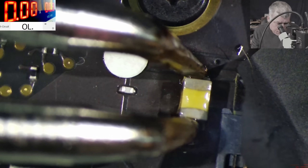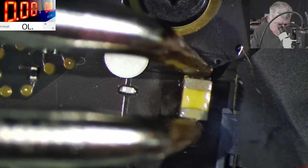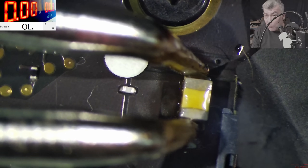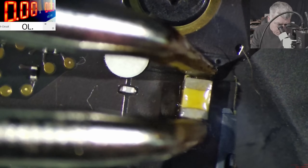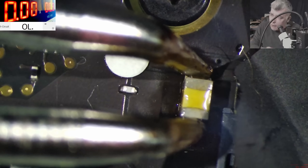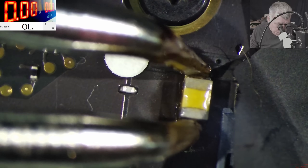About the battery disconnection — the battery is disconnected. When you have a short, the battery power management chip will disconnect the battery. The way to activate the battery again is to plug the charger. On the moment you plug the charger, that's when the battery gets reactivated. So in a case like this, it's okay if we have the battery connected.